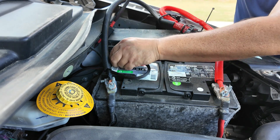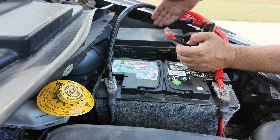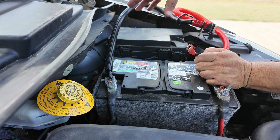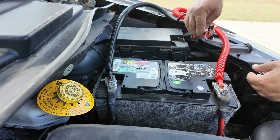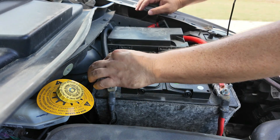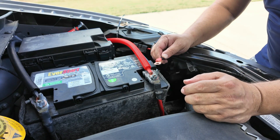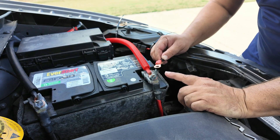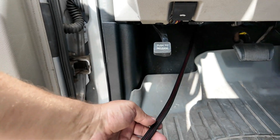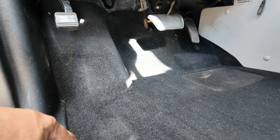With the wire run through the firewall, make sure the cable is routed in a way where it's not exposed to a lot of metal or engine heat, as cables do wear out over time. I have an Anderson 120 connector which I actually leave connected to the vehicle since the Convolt unit also makes a great jump starter. Complete your full install before making the final battery connection. The cables are definitely long enough, and the wires are tucked away nice and neat.